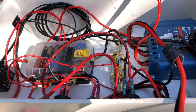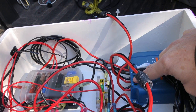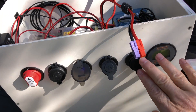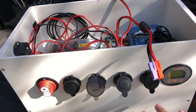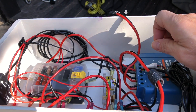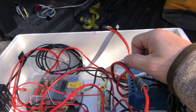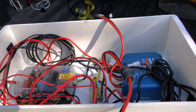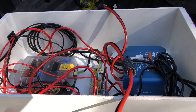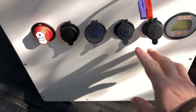This cable is connected directly to the load outputs on the charger. The front panel items — USB ports, cigarette lighter, etc. — are connected directly to the battery and do not go through the load outputs, because the load output is limited to 10 amps. The advantage of connecting to the load output is that the Victron's Bluetooth app shows watt-hours being used. So I connect my fridge to the load outputs to monitor its power consumption, since it's the big ticket item. Everything else just plugs into the front.